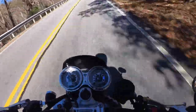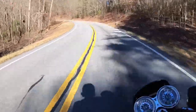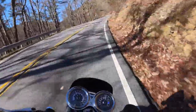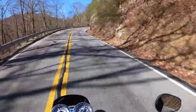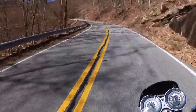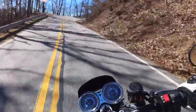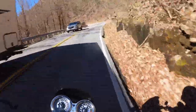Oh, the front end feels so much better. This is the bike that I wish Triumph would just build. Have the Speed Twin, and then have a Speed Twin RS. You don't even need Ohlins front and back honestly — take the Showa big piston forks off the Street Triple RS and throw a pair of Ohlins shocks on the back. The Showa big piston forks are really good and they're on the Street Triple RS at the same price point — both bikes are around 13 grand. Charge an extra 15 to 1800 dollars, throw a set of Ohlins on the back, throw the big piston forks up front, and you'd have yourself a Speed Twin RS. That would be amazing to have it all ready to go right from the factory.